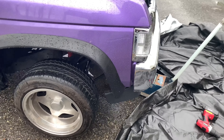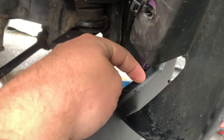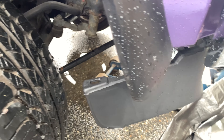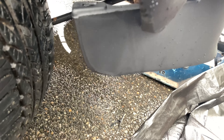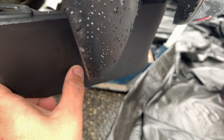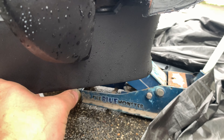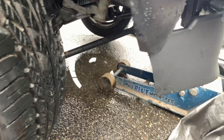If you have the fender flares it looks a lot better — it'll look like it's all tied into one piece. So with fender flares, you're gonna want to lift this up and drill a new hole probably somewhere around here. To start, we're gonna cut off a rough section — probably a good rough three and a half inches or so, straight down. It all depends on how you want to do it; sometimes I zig in a little bit towards the front. We'll start small, cut a straight line down, and see how it looks.